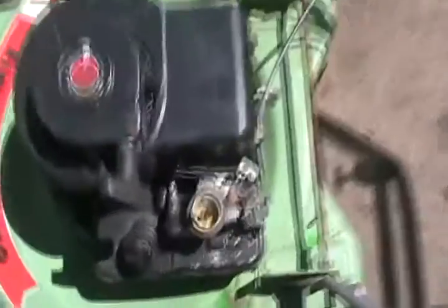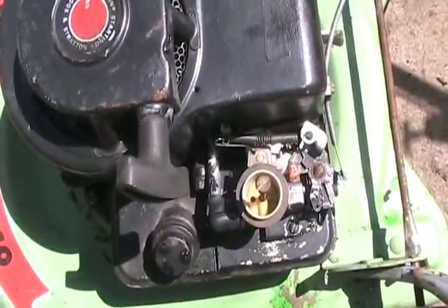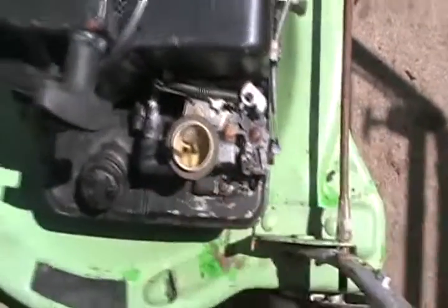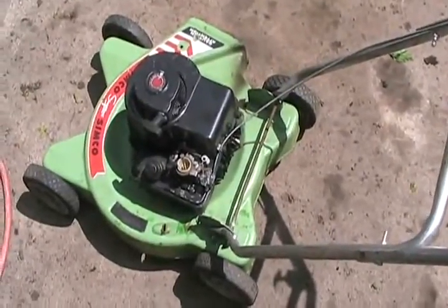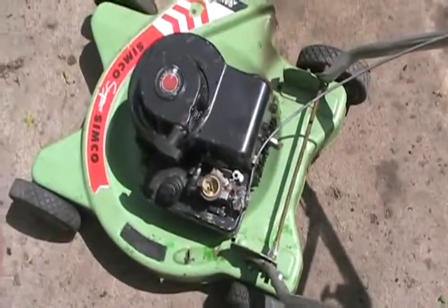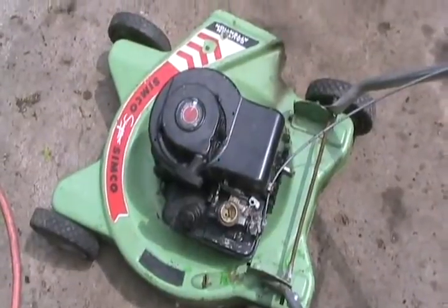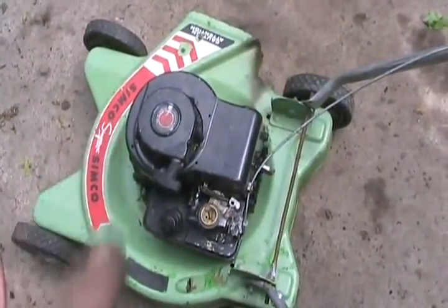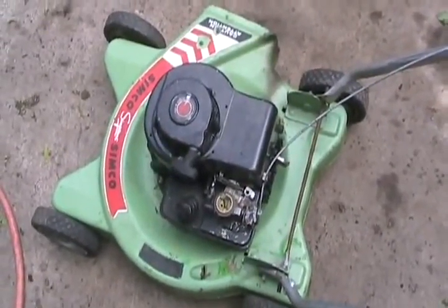The carb isn't adjusted right, but if the choke opens quickly after you start it, you know it's a good working carburetor. The fact that it started and died just means I have to open the mixture screw a little bit — that's in that direction. I'll try giving it three-eighths of a turn. When adjusting the mixture to get it finally right on these old carburetors, set them to full speed and turn out the screw until it starts chugging and puffing black smoke, then slowly turn it back in to make it leaner, just until it starts running the fastest — then back the screw out a tiny bit, like an eighth of a turn. That's probably the right setting so it'll always run good, have no bog in the long grass, and no problem starting and dying.